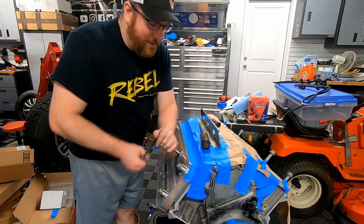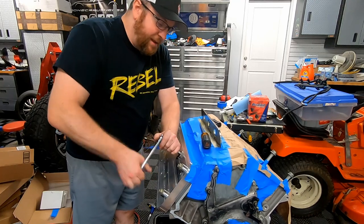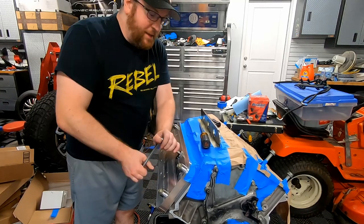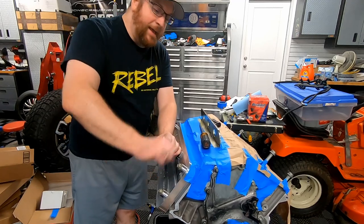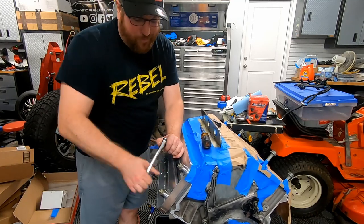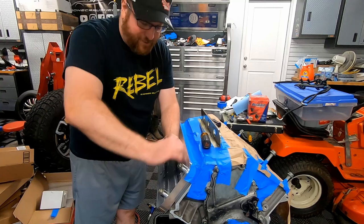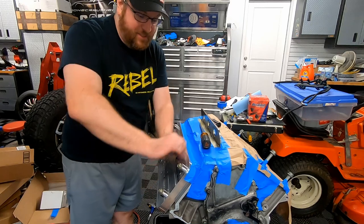And from the video, it said that we don't have to back it out because the way this tap is designed, it's designed to bring the chips up, because it's some kind of spiral flute design. So this is going to be quite tenuous at best. So let me go ahead and tap all these holes. I think this will take a long time. I don't want to use an electric ratchet on this. You could, but I'm not going to. I just want to do this by hand. And I may actually switch over to a half inch drive, just because, actually, yeah, there you go.